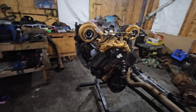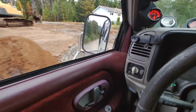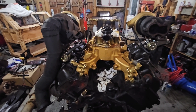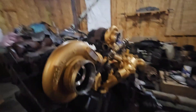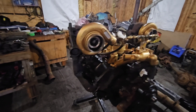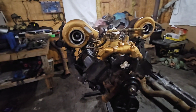That's what I was doing 4000 RPM burnouts on, and it still withstood it with impeccable durability — even ran with a blown head gasket for extended periods. I also re-honed the cylinders, got new push rods, and a new timing chain in the motor, which is going to help drastically. The new upper intake plenum is going to eliminate all the boost leaks from that area and give a much better factory OEM fit overall.